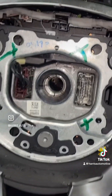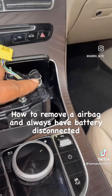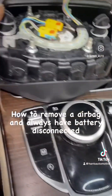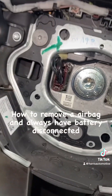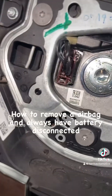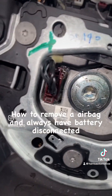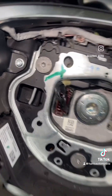So now we're going to tighten up the steering wheel and install the airbag. This here is your airbag — it's held in by these two retainers here, one on each side. It clips into these springs. How you release these springs: you go through the side of the steering wheel with your screwdriver, just push up against it, and that's how it gets released — and that's what holds it on.